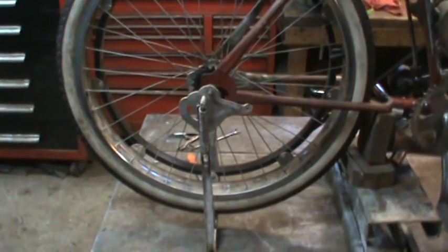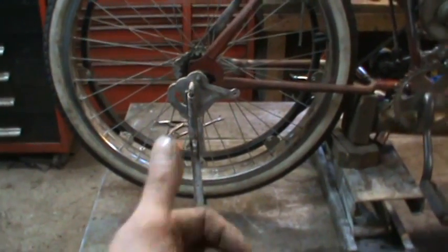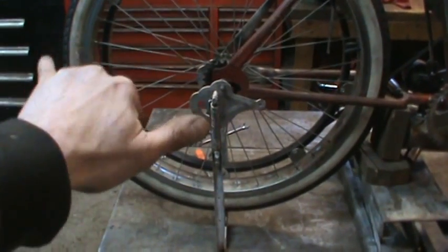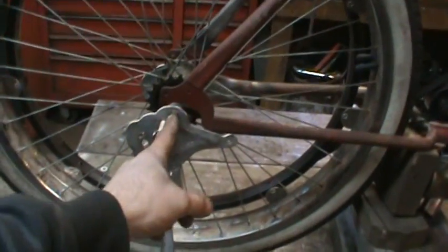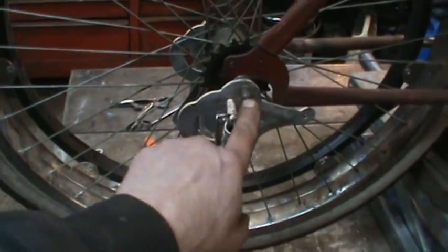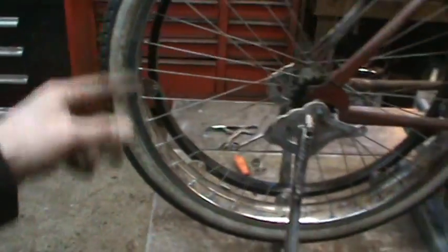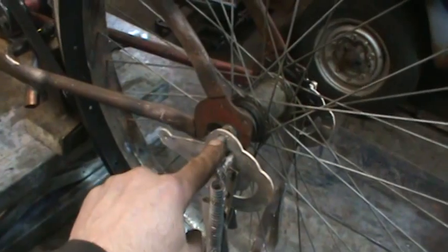So it's gonna be a bit of a fitment adjustment. In the down position, it clears the wheel, but when you click it to the up position, you figure this is a straight line. It's as long as it can be. Now it is pivoting from there, not there. So when you flip it back, it now hits the tire. Believe me, it does. So we have to, more than likely, change where this point is.